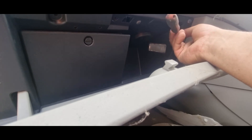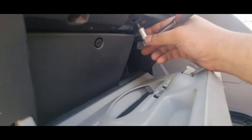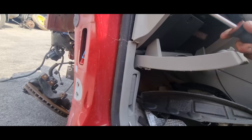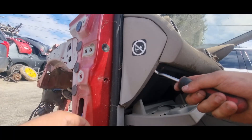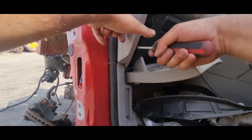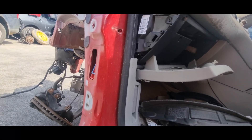I will be removing only one of the middle ones. Remove these four Torx screws, and then after these are off we're going to be removing the side trim cover for the glove box. Gently, with a flathead screwdriver or a clip remover, apply pressure and remove the cover. On the side there are only clips, and I'll be detaching them with my hand just so the glove box can come off.